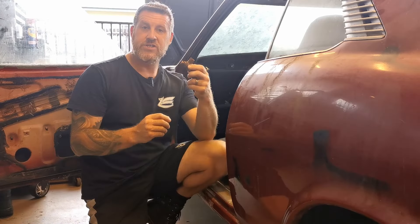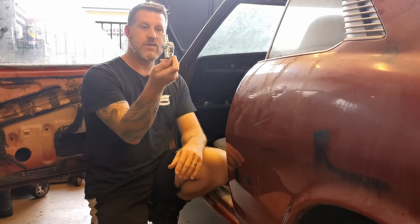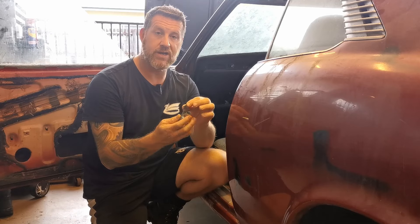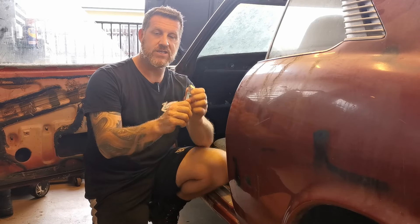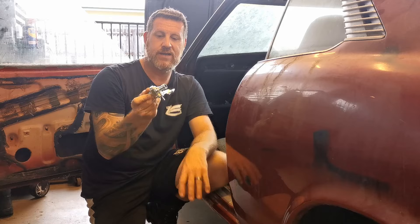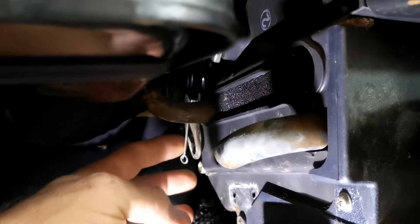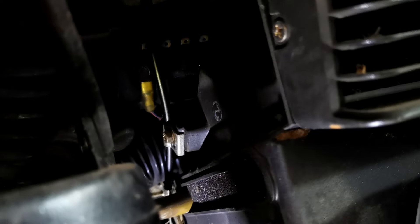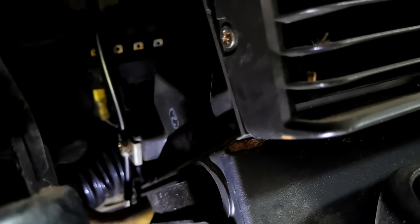Junk, no good. The original is built at a 90 degree angle for the feed — weird bracketry rod. I found a replacement which is universal but it's straight through. The solution is this bracket here will clamp onto the cable which then actuates this, and there's also a bracket on the cable to hold it in place so everything stays solid and it will open and close with the control. I need to figure out which way the switch moves so the cable being down or up means hot or cold, then make sure it's orientated correctly so hot equals open. I'm not going to film this part, but there's a little bracket I need to take off so I can mount the other tap to this cable, bolt it back in, and modify the hoses to fit a straight-through fitting rather than a 90 degree.